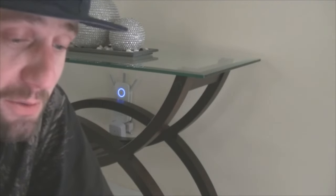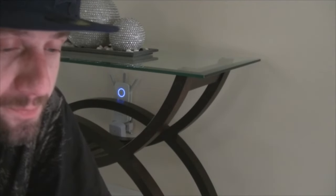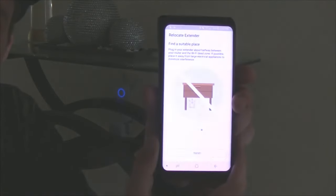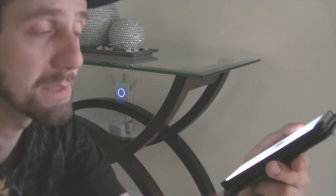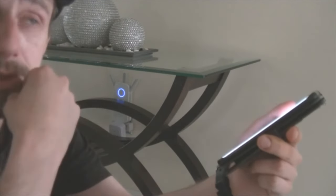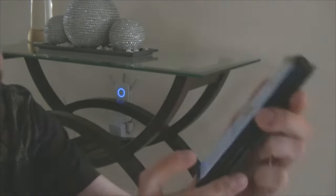We're at 'Applying Your Settings' — give it a second. Once it gets to 100% it's going to take you to a screen that says 'Relocate Extender,' meaning put the extender where you get the best speed. Our router is in the basement so I have the extender on the main floor in the middle of the house, and that works fine for me. Click Next.